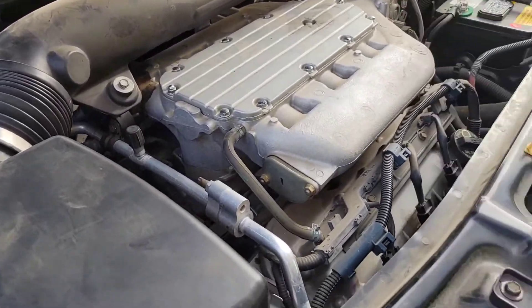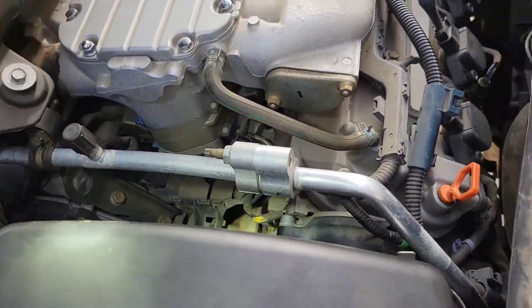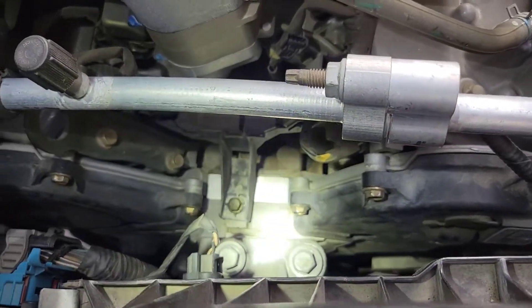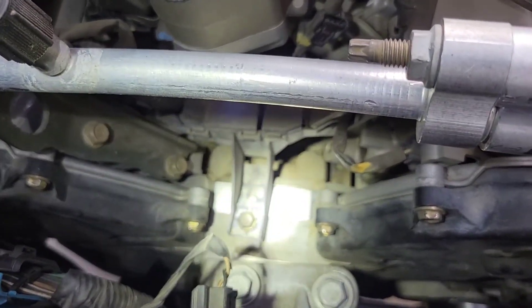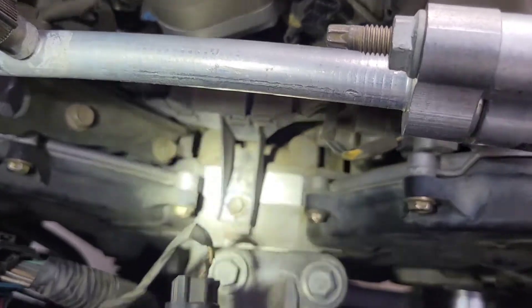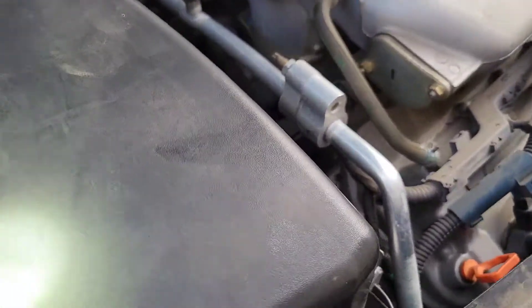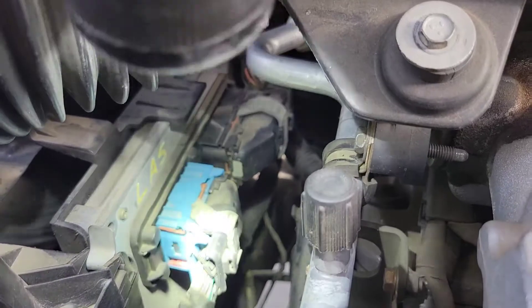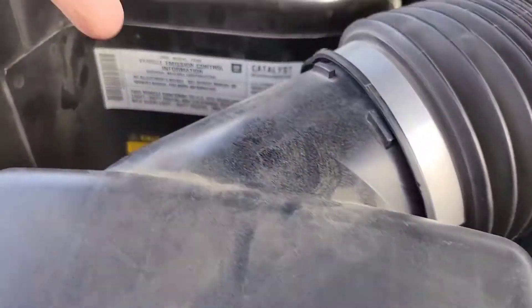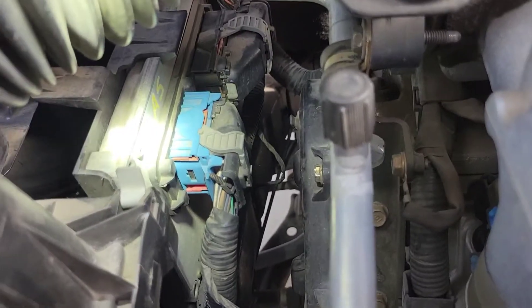Timing belt on a 3.5 liter Honda or Acura. Now this is a Saturn, so it's going to look a lot different. If you have a Honda or Acura, you're going to have a power steering pump right in the valley. It's going to mount up and it's going to be in the way. You're going to have to unbolt it and move it out of the way because you have to get to the engine mount and the engine mount bracket. On the Saturn, the PCM is back on the side wall. On a lot of Hondas and Acuras, the PCM is actually over here and you have to take the PCM and bracket out to get to the engine mount. On this one, all you have to do is take the airbox out, take the PCM out, and you can get to it.